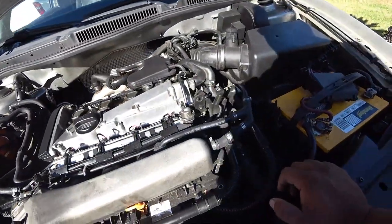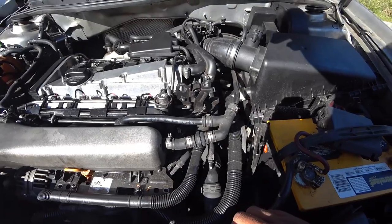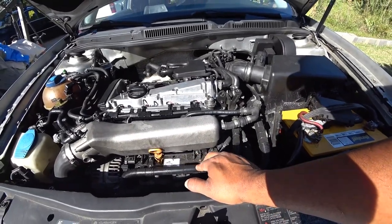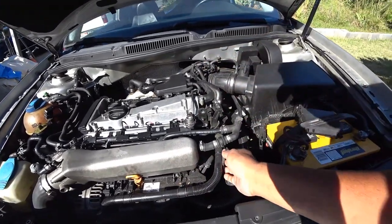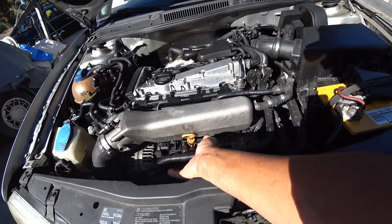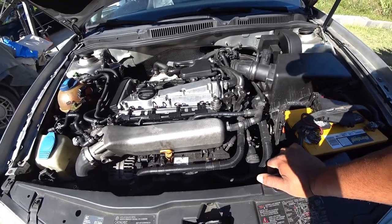Another good thing to look for is on the brake booster hoses — same thing down below, look for any cracks. These very rarely fail but they do fail, so just pay attention to that. Down here in front, the main sensors for the combi valve and the wastegate — these are also super notorious for cracking. These are plastic lines right here and they break all the time, so just inspect and put your hand down underneath. Good word of advice: turn the car on and listen for it.